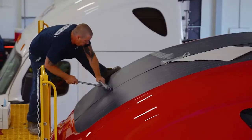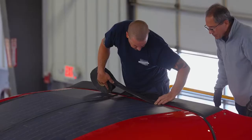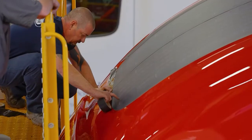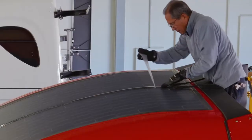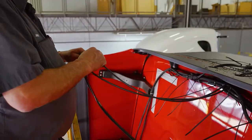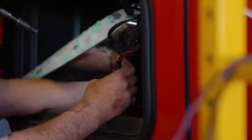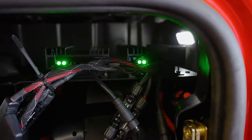As that's done, we use a roller to roll it in place and set the adhesive. When the module is fully installed, we then use a tape to further blend the module into the vehicle. We install the solar modules, then install the charge controller, and further bring the wiring from solar to the controller and then on to the battery.